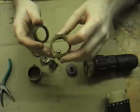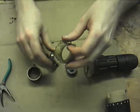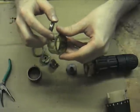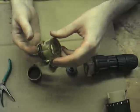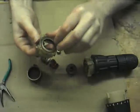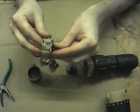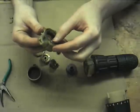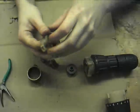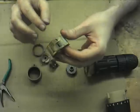You see this gearbox actually has teeth cast into the plastic here. Those aren't actually gear teeth for engaging with the planetary gears, they're for engaging with the annular gear. So, you notice this has these little slots in the side. This will go inside there, and in one position the annular gear will be pushed forward and locked in place relative to the gearbox housing. But if you slide it back, maybe even just 4 millimeters, it slides it back just far enough that the annular gear can begin spinning freely. And just like the clutch mechanism, when it's spinning freely, it's not transmitting any power. So it's essentially removing a gear stage from the gearbox.